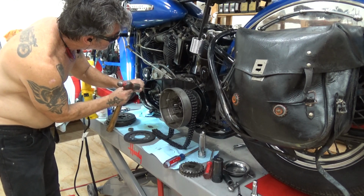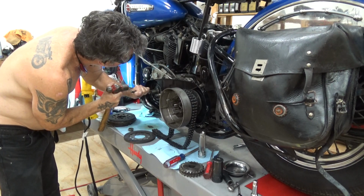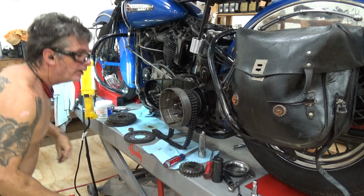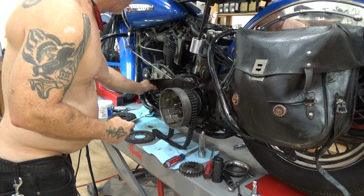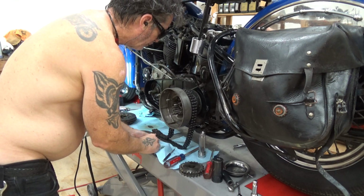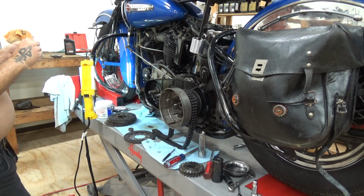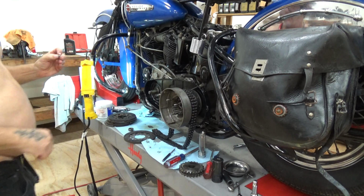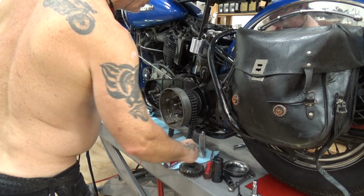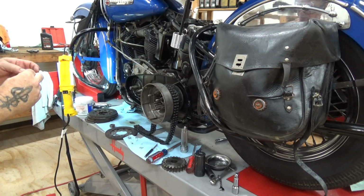Pop this back out. One. Out of there. There we go. Now, what is going on is I have a couple thousandths too much on this keyway. That could be from how it was made, could be corrosion, could be coating, whatever. So I'm going to step away from the video. You're going to hear me in the background, and take some vice grips, put it on here, go zip zip on the Scotch-Brite wheel until I no longer have a press fit. I can't have any slop. Slop is bad. Slop, I ruined the keyway. The press fit will fuck me up.